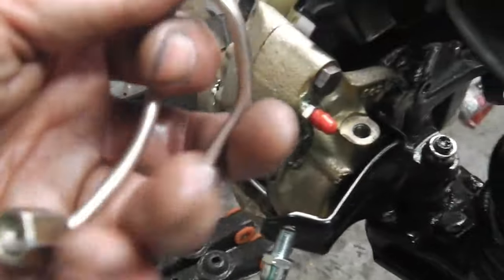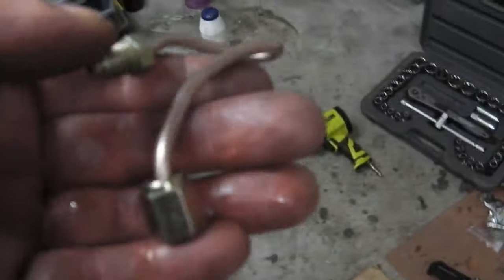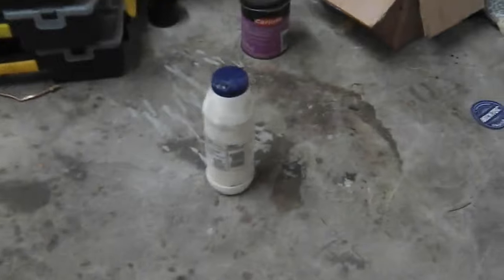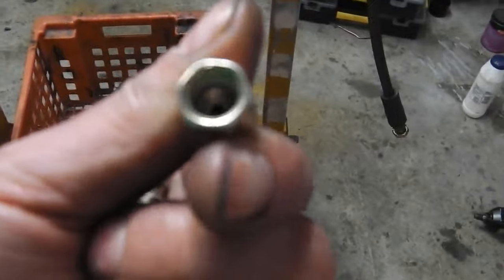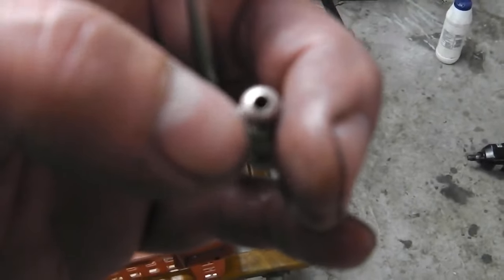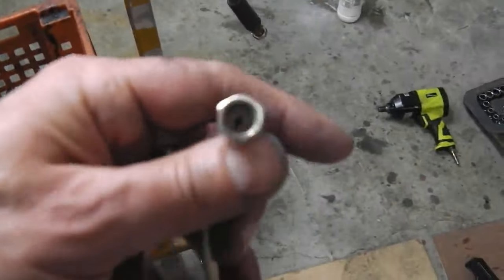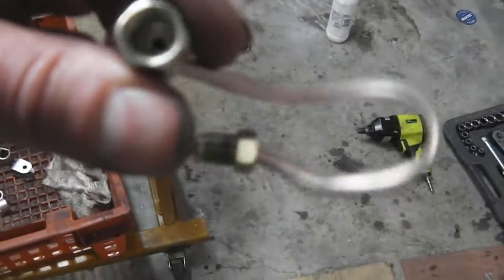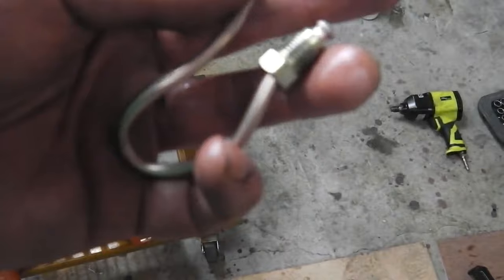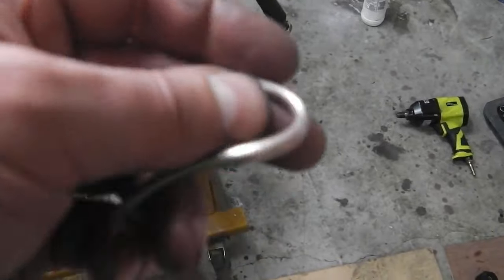So that is it. Now there's some tight curves, and we've got a little tip for you to get tight bends on there. Fill it with salt. There's our table salt down here, little tip. Sounds odd, but on the female end I was able to use that as a funnel, taped up this end with some Tesa tape, or you could just put Blu Tack on the end, or anything, just to block that hole so we don't let it go inside, of course. Then fill that with salt, tap it, do it when it's straight, obviously. You've got to do it when it's straight, and the copper will fill up with salt. That stops it kinking. The salt can't compress internally, and you can get some curves.